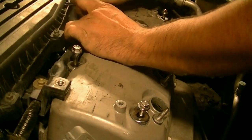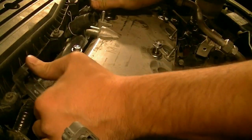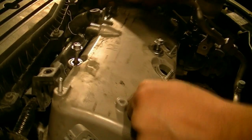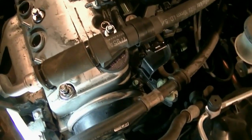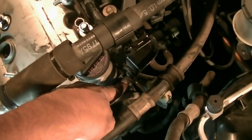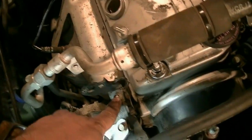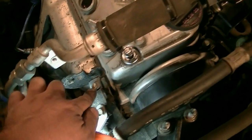Now we get this wiring harness off and we should be able to remove our valve cover. Looks like I forgot to take out some stuff. This bracket here is held into the valve cover — we have a 10 millimeter bolt. That's where this AC line and power steering pump needs to come out, so we're just going to take that bolt out and remove this bracket. Also this little small bracket for the wiring harness also needs to be taken off — it's also held in by 10 millimeter.